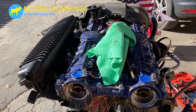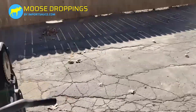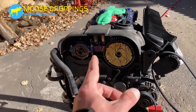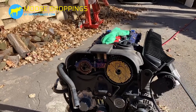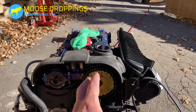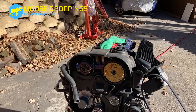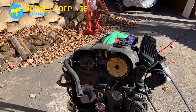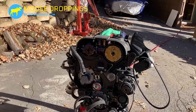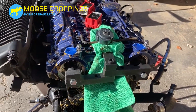When you are doing a timing belt, you are going to use the cam locking tool and it's going to lock everything in. We did our first head gasket without any locking tools — we just used the alignment marks, and when we fired it up we had a cam position sensor error and it happened to be off a tooth. One or even two teeth will throw that error, but it's not catastrophic — though if you are off far enough you'll do serious damage and be ripping your engine back apart. The cam locking tool is T30 to remove the caps. Here's what the tool looks like on the end — a 12-millimeter brings it in and then a six-millimeter clamps down on top and squares everything up. Now we know these are locked into position.